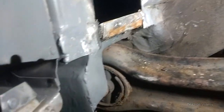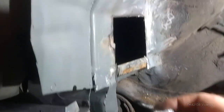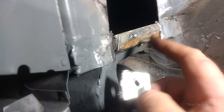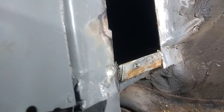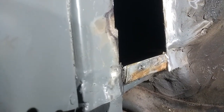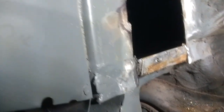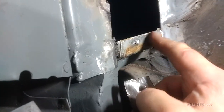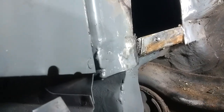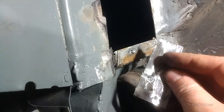This is the importance of investigating the overlapping welds or spot welded panels on cars when you're restoring them or repairing rust. All modern cars are made using spot welded and seam welded panels, sometimes a combination of seam welds, spot welds, and bonding agents - high-tech glues. This car being from 1992 is spot welded, and because spot welds overlap panels, they're all essentially lap panels. This is obviously where the seat belt mount was - I've cut that out - but when I drilled out one of the spot welds, the old weld wasn't really attached and there was rust behind it.